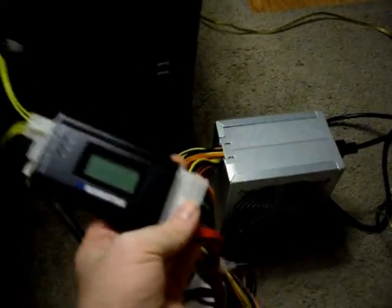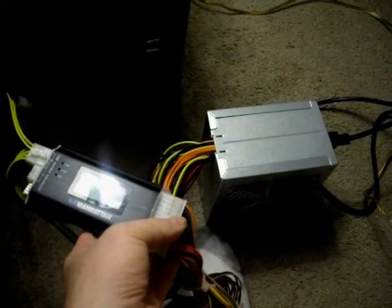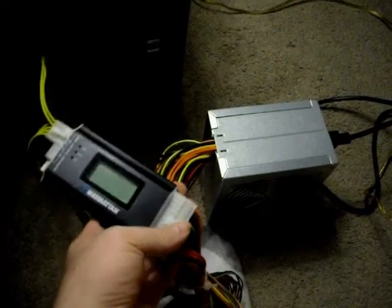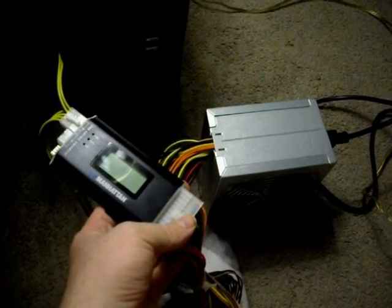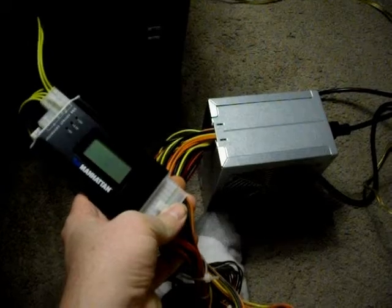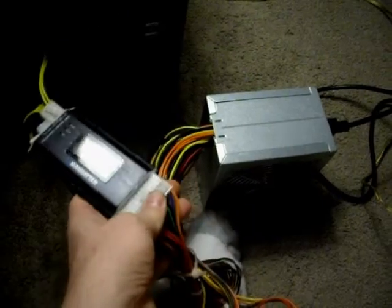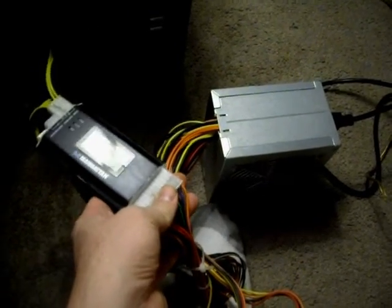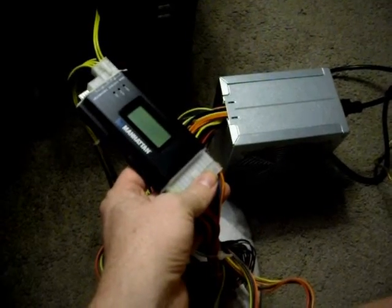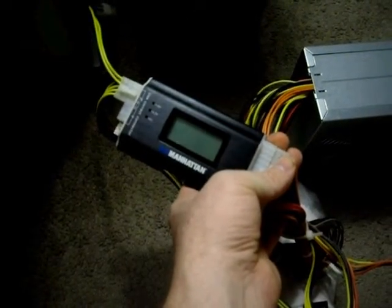You also want to make sure that you're supplying a load to this power supply, because anytime you're using a power supply in your computer, it's going to have a load — the CPU, hard drives with the motor spinning. Testing it blank with no load is kind of silly. It's kind of like seeing how many weight curls you can do with a 2-ounce bag of chips — you could go all day long, but when you give it a real workload like 20-pound dumbbells, you're going to significantly slow down. That's what you want to check.